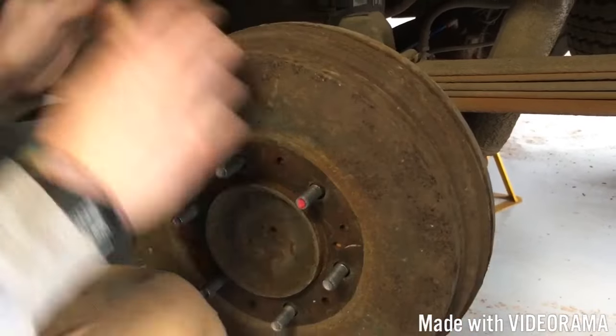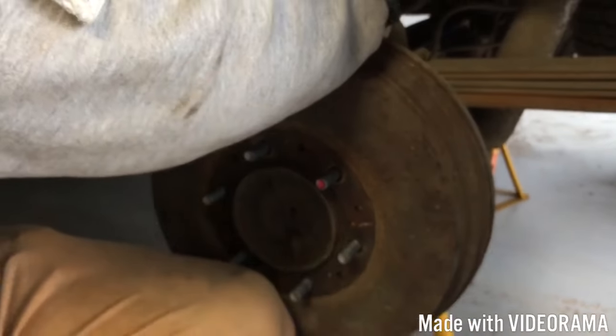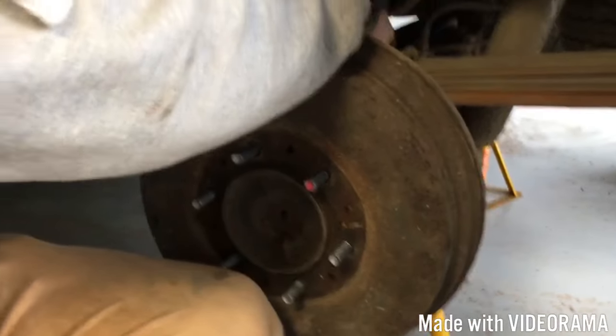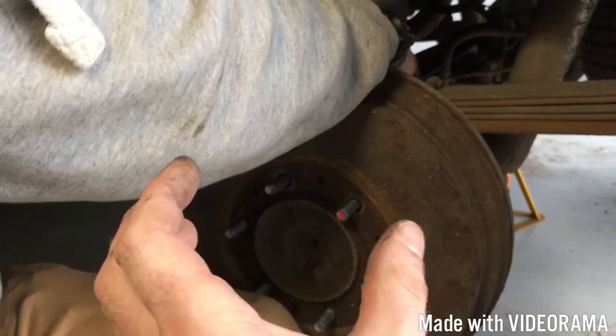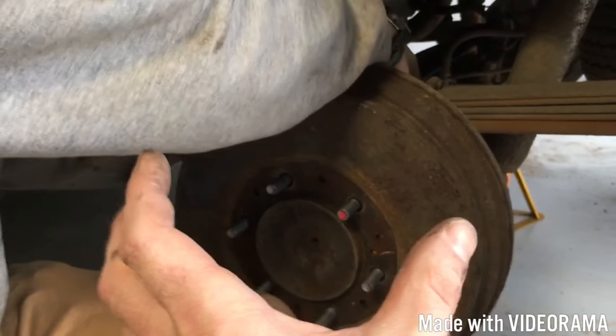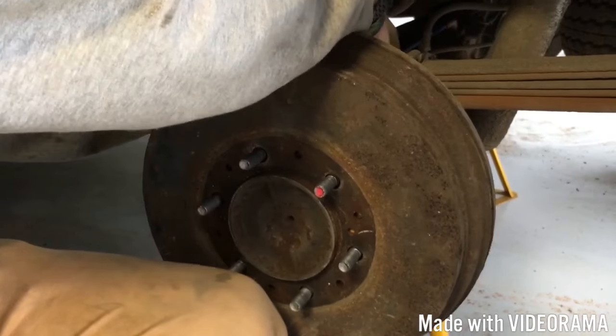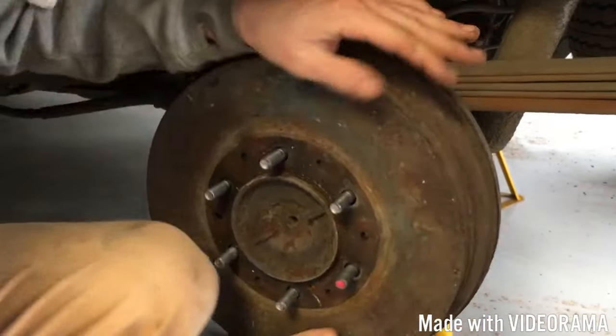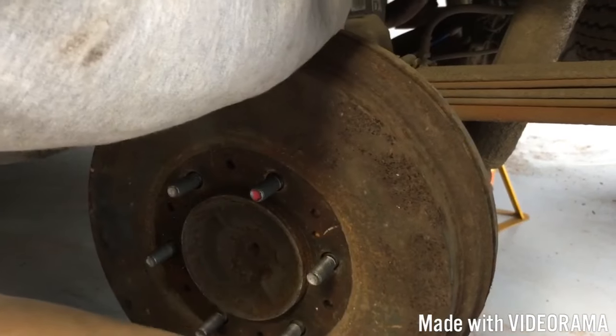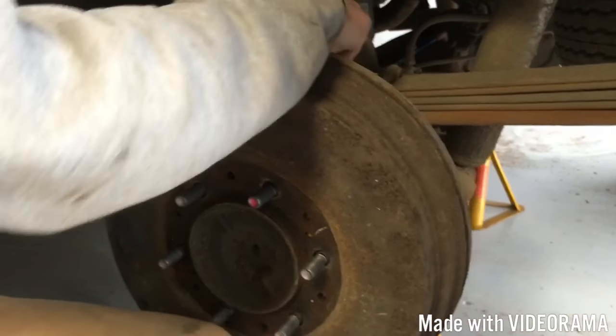What we're going to do is get it so it's just tight, and then we'll go and put the handbrake on a couple of times just to centralize it - just to make sure it's not pushing out one side more than the other. That really centralizes it and we can start - it's rubbing now.